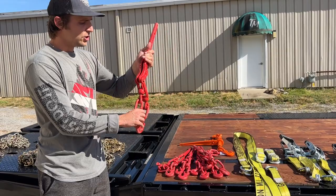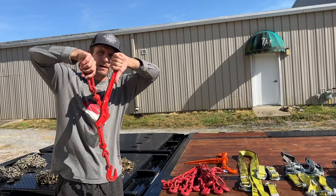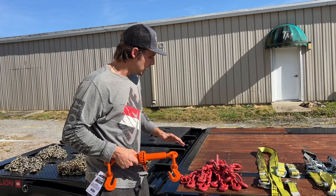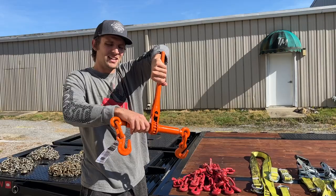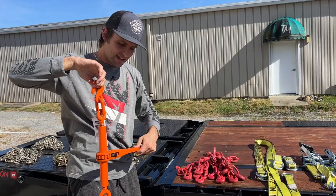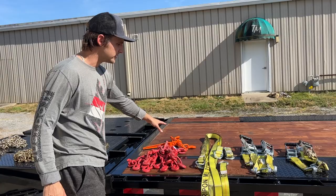You're going to need binders. I've gotten a lot of backlash on the lever-type binders, and I'm not going to link those below. I just bought these ratchet binders and I'm going to get more of them. These are much safer when you have things with axles and you need to secure them to the frame. I'm concerned that lever binders can pop open, but these ratchet binders are not going to pop open. They have more expensive ones, but this will do just fine — it's almost overkill. Get six chains and six ratchet binders.